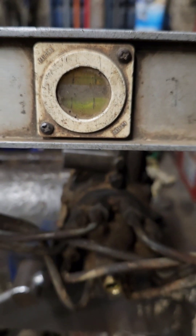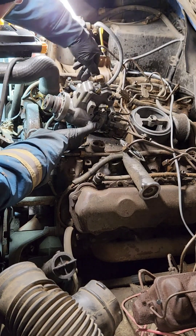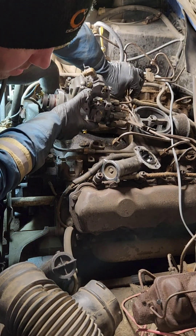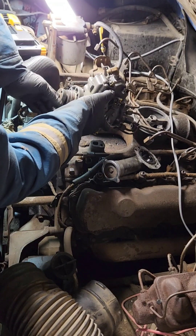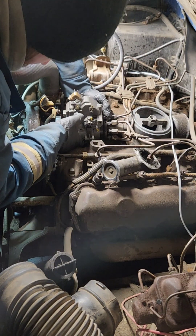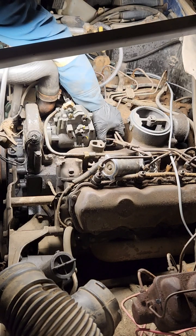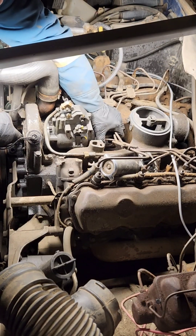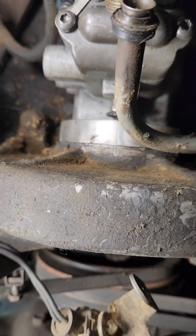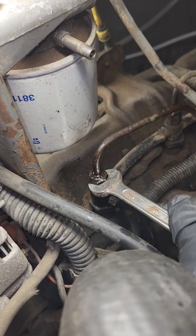It's best to throw these lines back on while it's in a vice instead of fighting around while it's inside the truck. If you could do that, I'd give you a hero cookie. About three weeks into the course I blew the engine — bent four connecting rods and took out the bottom end. I just couldn't take it easy on her. Those cast iron rods just didn't see it coming. Then I saved up and got some Eagle H-beam connecting rods and a 4340 Scat forged crank. One wasn't quite right because the pistons came out of the deck a sixteenth of an inch. You can't really screw this job up — it only goes in one way. Get her onto the dowel pin, then line up the timing mark. This is a very important part — you don't get this right, you'll be runnin' rough. Get her lined up and button her down. Righty-tighty, lefty-loosey.